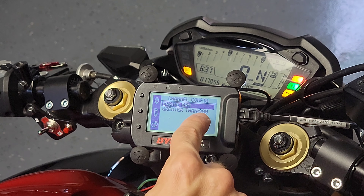Here I am on the bike for my third or fourth test. You can see the LED leads dangling — this isn't the final position, just testing. I'm turning the bike on to verify the green light still works, confirming it checks for wide open throttle. I'm expecting the light not to turn on when I just put the key on — perfect. Now giving it throttle — you can see the light turning green, so things are working correctly. Turning the bike on, the red light and the blue external LED both appear, confirming the RPM alarm is working.